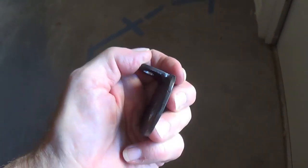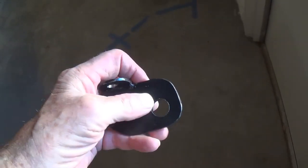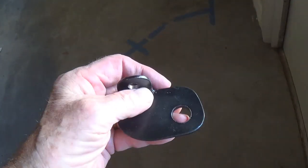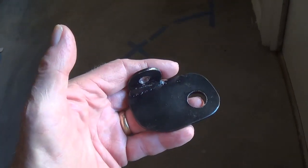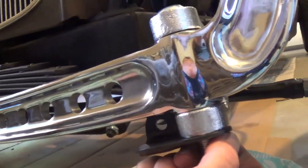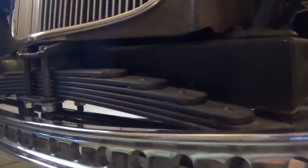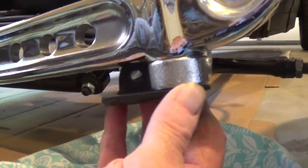First off, I cut a piece of 3/16ths inch steel and made a bracket that will bolt onto that 5/8ths inch stud that comes out of the bottom of the split wishbone bracket. I have the tab here with a 3/8ths inch hole drilled in it. I could have simply bent a tab up and had this all out of one piece, but I didn't have the right piece of metal, so I did it in two pieces — I think it's going to be plenty secure. I'm going to install it here on the exposed thread at the bottom of the big bolt that holds the split wishbones to the front I-beam. As you can see it pivots a little bit — I'll have to make sure it's aimed exactly straight over at the bracket that's going to come down from the bolts holding the spring to the front perch. So there's step one.